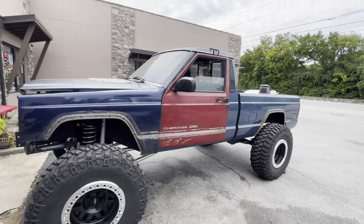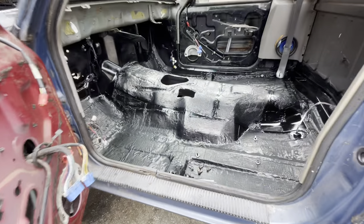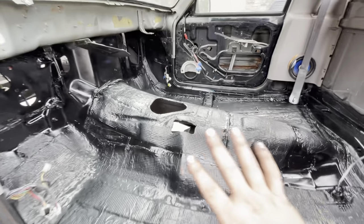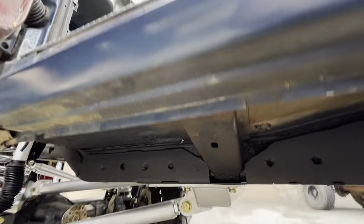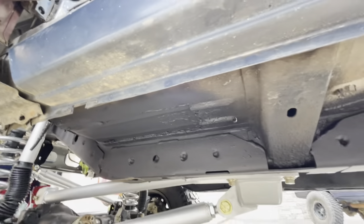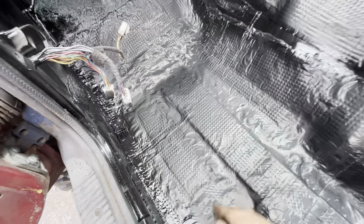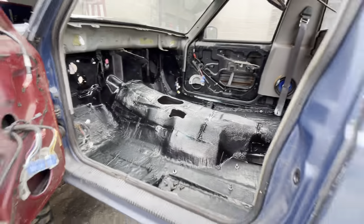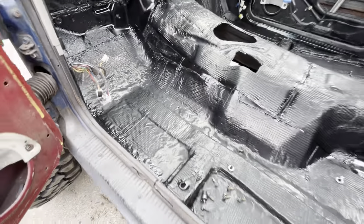We've also done some interior work - the interior is almost ready to start putting back together. Really proud of this. It was half-assed but it came out really good. Instead of doing a full tub - we could not find a tub - so we had to just patch the rust. We did patchwork, sprayed over it, and you can see some of the patchwork. It's been welded. A lot of people will cut a patch and then spot weld - tack, tack, tack - and then sealer. But these unibodies like to flex a whole lot, so when we did these patches we actually welded them all the way across so it's all connected and strong.